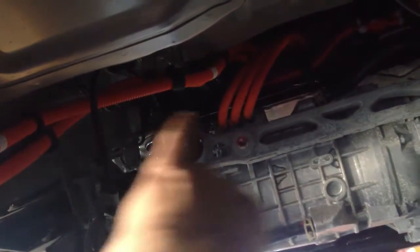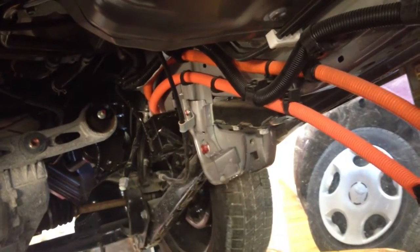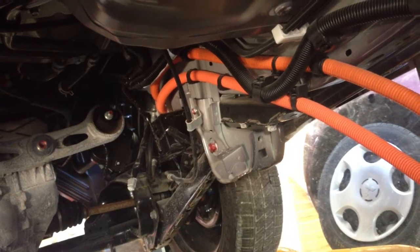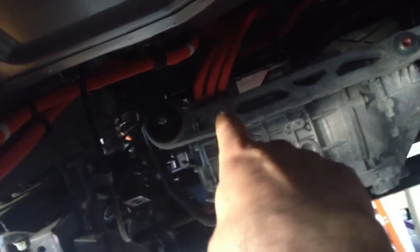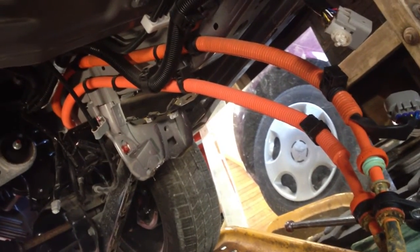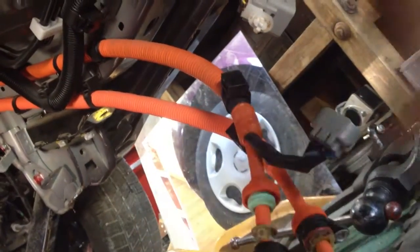These are the two main battery cables, and the J1772 ties in with all that. On the other side of the battery pack, cables go straight to that high-power DC connector — they don't run through a charger. When you do high-speed DC charging, that's a real off-board charger; it's not an internal charger in the car — it goes straight to the battery pack. That's why it's so effective: high voltage, high power, off-board. The battery pack has both a power connection and a data connection that goes up to the charger as well.